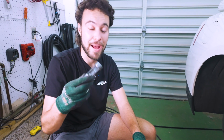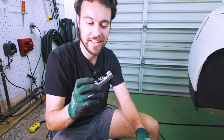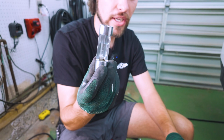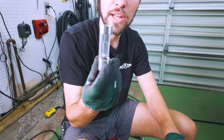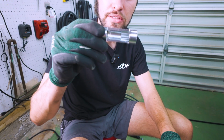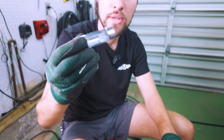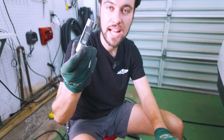So making a dramatic entrance, we have the strut socket. And I didn't know this existed until recently, but that top bolt is a 17mm, and this socket has a pass-through for the wire, so we're able to use this freely with a normal ratchet, and it won't give us any troubles. I highly, highly, highly recommend this if you're doing it.